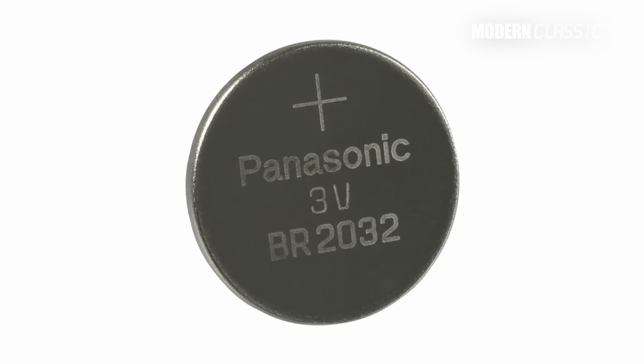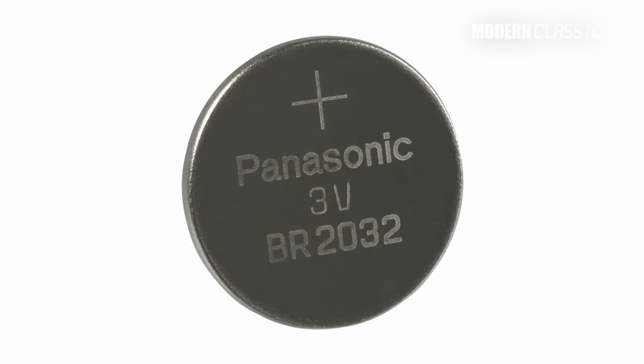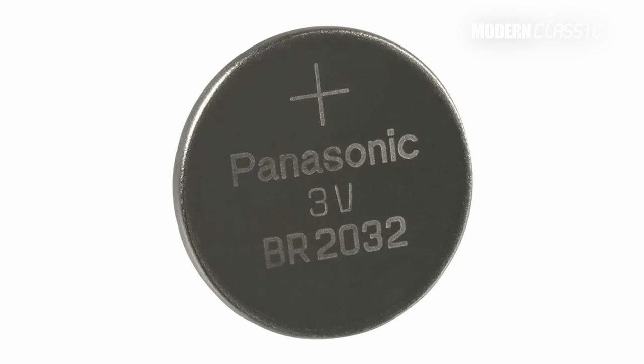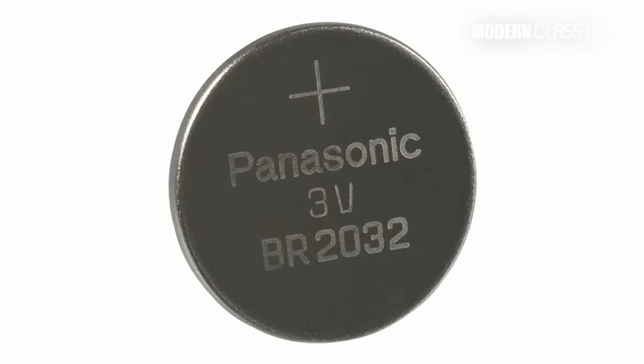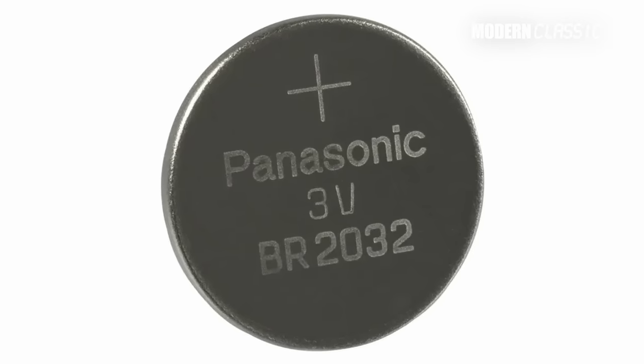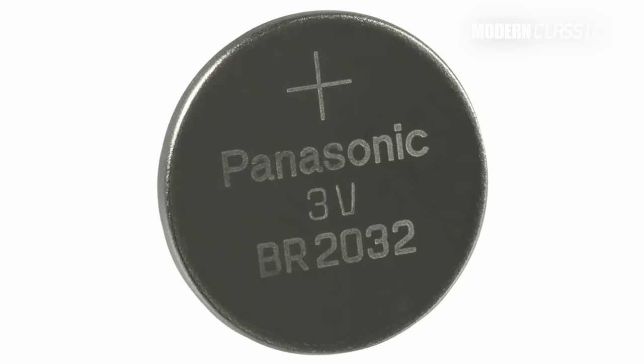As for the prefix, the difference is the chemistry. BR batteries are a little more tolerant of high temperatures, but others with this system have used CR2032s successfully. If I need a BR2032, I can just order one, and we're making it a drop-in replacement.